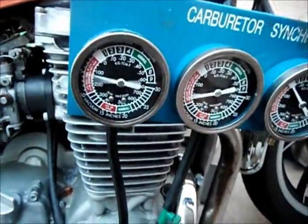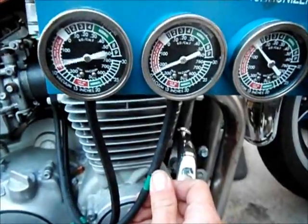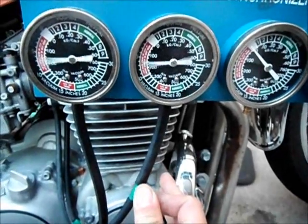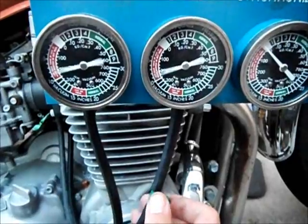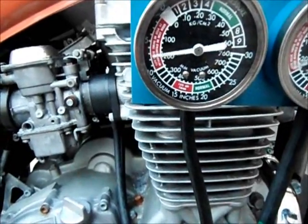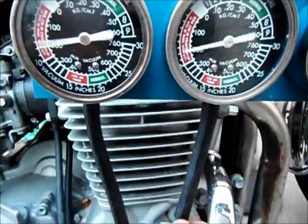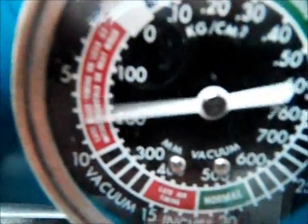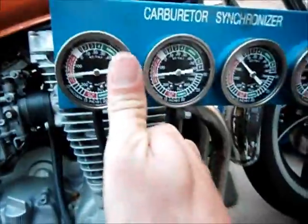See how quick it cranked up? The bike should crank that fast. The bike isn't fully warmed up right now, so the gauges aren't going to be reading exactly like they should yet. If I open this valve up all the way, see how crazy the needle goes? I'm going to close it just enough to where I get the needle just barely bogging — and that's about where I run mine. They're bogging right at about 8 right now. As you can notice, both needles are doing about the same — that's what you want right there. That's a good thumbs up.